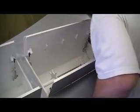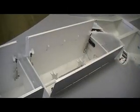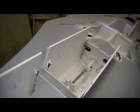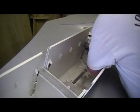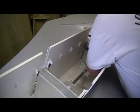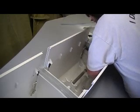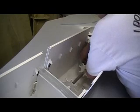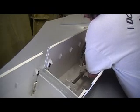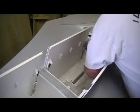Someone asked me what grit paper to paint with. I'm hitting my parts with that slick paper just to get them smooth so they won't stick. But with painting, I usually stop at 600. Stop at about 600 is fine. Once you use that 600 a little bit, it gets that sharp edge off. That's usually all you've got to do.